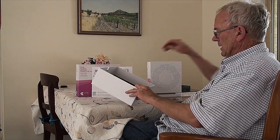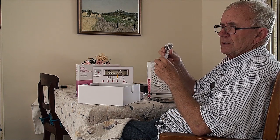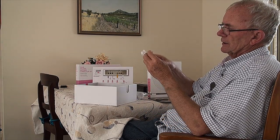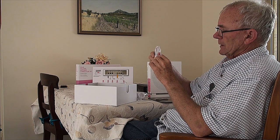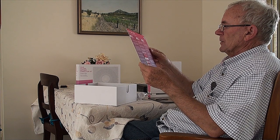Then in the bottom of the box you get a power lead to hook into your modem. You get a grey cord to go to your wall phone socket straight to the telephone. You've got to have a digital telephone — some of the old telephones will not work. But if you've got a digital phone, you should be able to get it working with that wire. Then there's the wire you'll need to connect it to your computer. So there's all the material in the box. If you've got an ADSL filter in your telephone line, remove it — you don't need your ADSL filter because it will block the signal. But you will need this new cord. Plug it into the modem and follow the instructions on how to connect it to the internet.